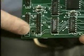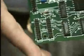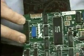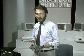Now these two 20-pin connectors allow this to accommodate two hard disks. Each disk has its own 20-pin connector, and the 34-pin connector is daisy chain. The 34-pin connector is up here. It has two connectors on one end. It generally doesn't matter which 20-pin connector you use when connecting the first hard drive.